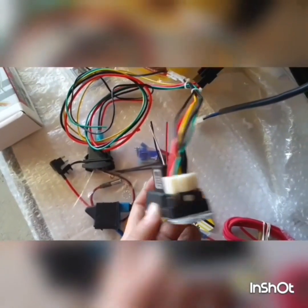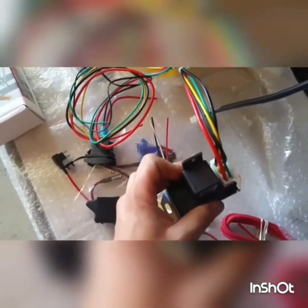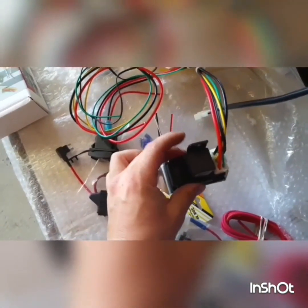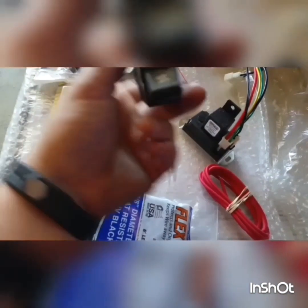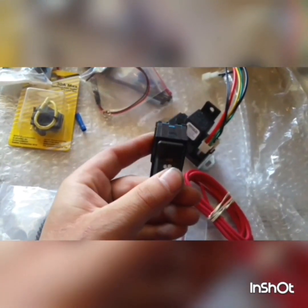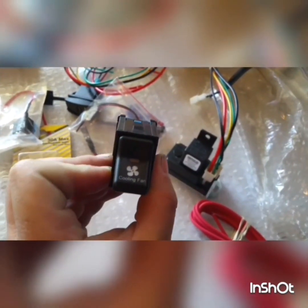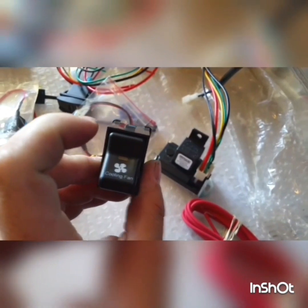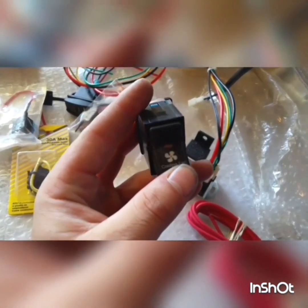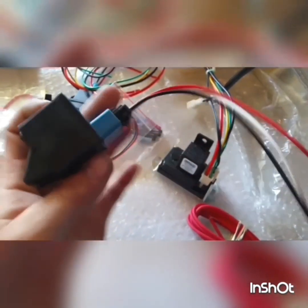I really like the module itself because it came with the wiring and a nice plug, and it seems more compact — it can just easily be fixed to the frame. With this control kit there's an override circuit, so I picked up a switch that cleanly mounts into the dash panel so I can turn on the cooling fan whenever I want. Say I'm towing uphill and the fan's not turning on — I can override the fan and turn it on.